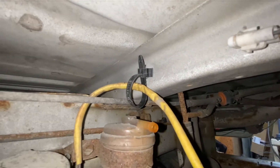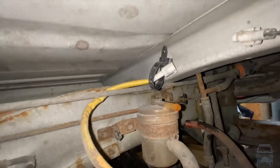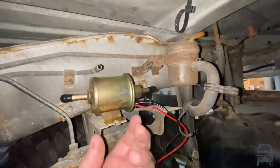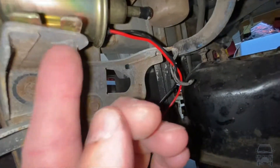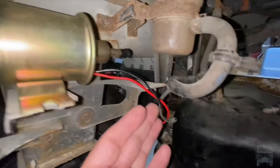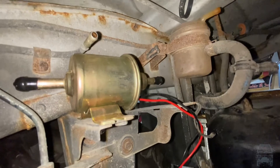Amazingly I was able to pull that pin back and then just keep pushing that down and it opened up a lot easier than I expected. So if the fuel pump's here, I think what I can probably do is bend this tab down this way, stuff that behind this bracket here, get a bolt through this hole, get the wires connected, and get this line to do kind of a half loop and go over here.